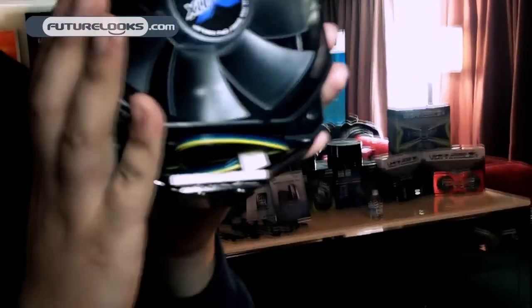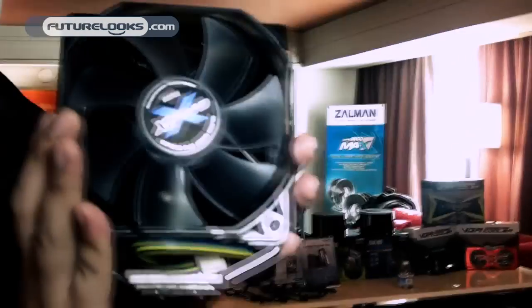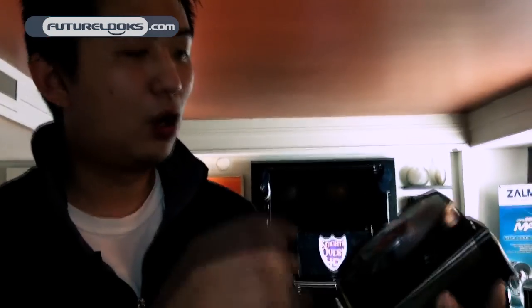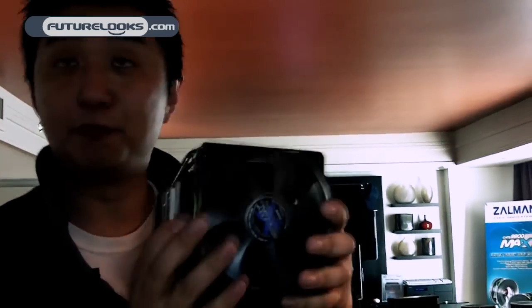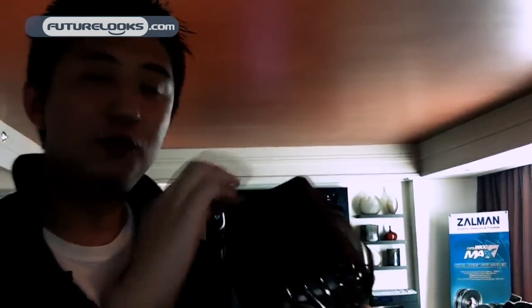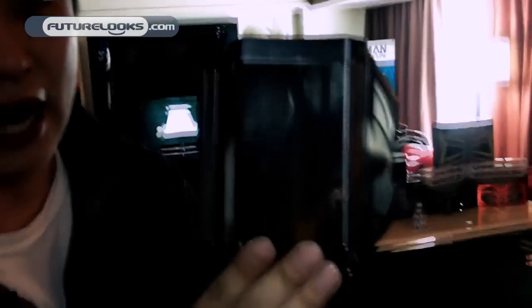This heat sink has a Q-Max of 350 watts, which is the highest Q-Max heat sink we have ever made, and the performance is absolutely superb. It's also very light — about 620 grams. Removing the center has made this heat sink a lot lighter, which is good because you don't want it to rip out your motherboard during transport. You might think removing the center reduces cooling capacity, but we've made the fins much denser, so the fin count is actually very high — you get the best of both worlds.